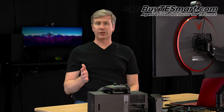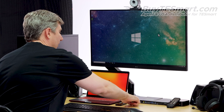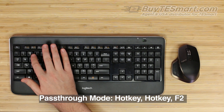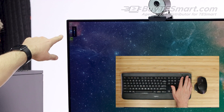One of the best new features of these KVMs is called pass-through mode. It gives you better mouse and keyboard compatibility, so we recommend that you leave this on all the time. You'll know when it's off when the mode LED light is not activated. To turn it on, press scroll, scroll, F2. Now you'll see the mode light has come on. And when we use our multimedia keys, like volume up or volume down, you can see that we have multimedia control of our computers.